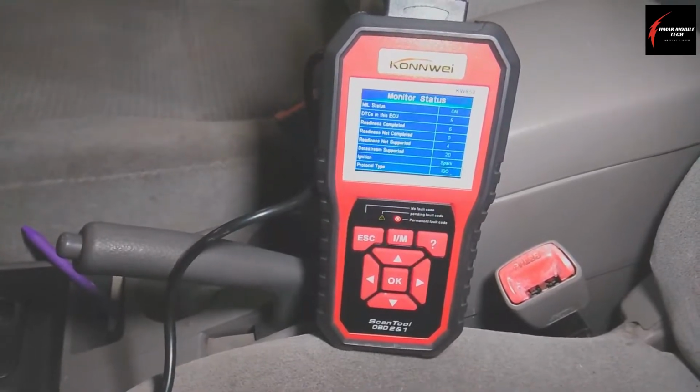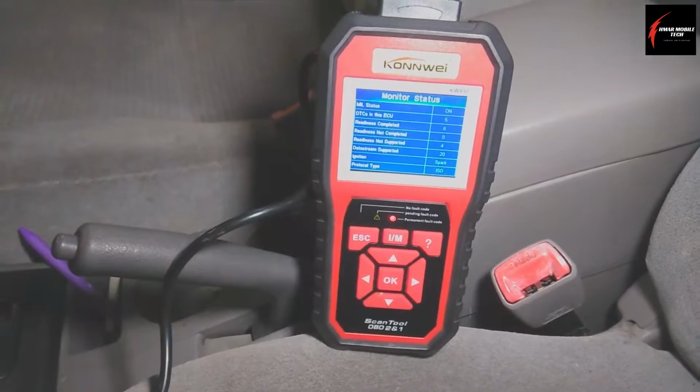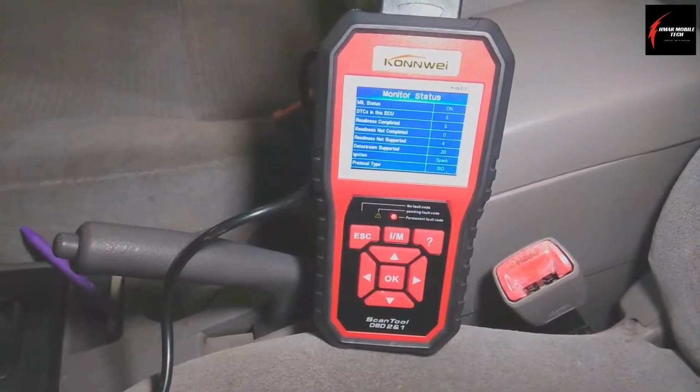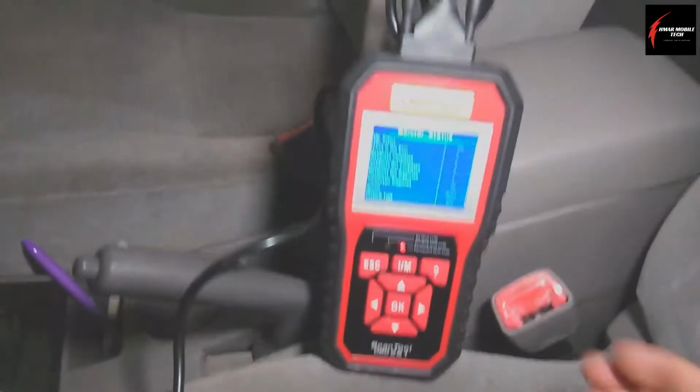Then you go and you touch the two terminals together, positive and negative, while disconnected from the battery on a single battery system. If you've got two batteries, you've got to make sure all batteries are disconnected.